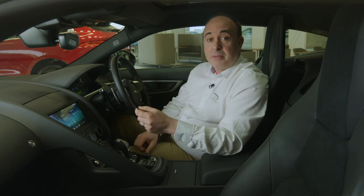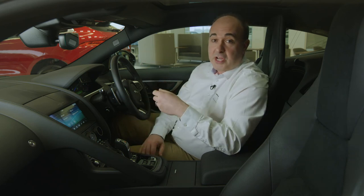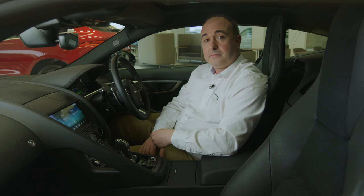This is most common on petrols when they've been used under load, like towing. It's not for me to judge how you use your F-Type. Find occasions to lift off the throttle and slow using engine braking to clear the filter.